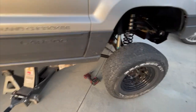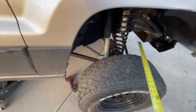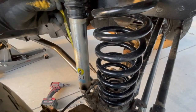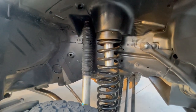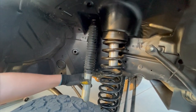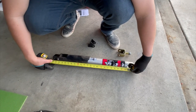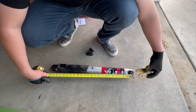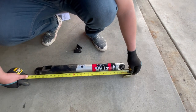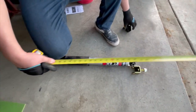We have to measure the front as well. You're definitely gonna need a big jack or some pieces of wood to stack up. You want to undo the shock — I undid the sway bar as well because off-road I'll be running without sway bars. Measure at the bottom where the shock goes and then at the top. This one's about 26 inches, so we want the shock to be about 27 inches so you're not overextending it. The shock itself from eyelet to eyelet is about 23 and three quarters — a little too short, but we're adding pieces to make it fit. This will add an inch and three quarters, making it about 26 inches, and the extension on the bottom makes it about 27 and a half inches, which will be perfect.